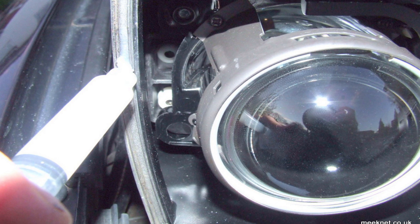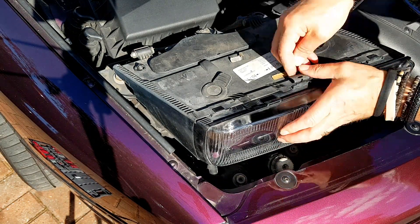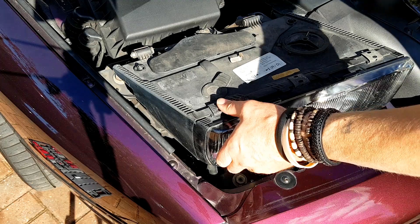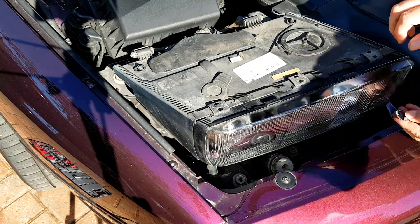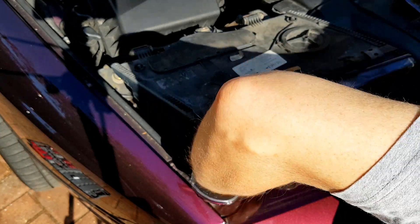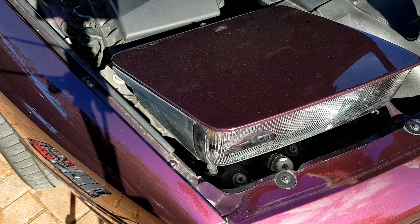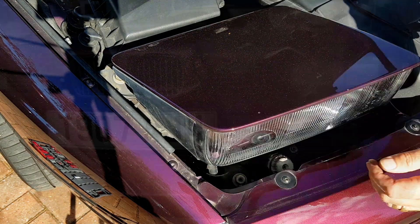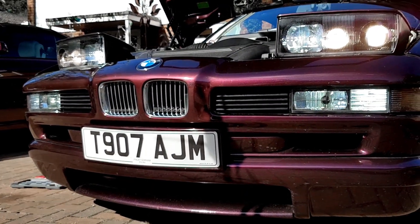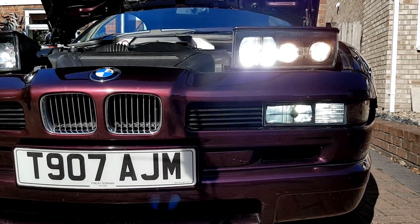Put some silicone grease on the headlamp seal and refit the glass, starting with the top clips. The reason I said keep the bottom clips separate is that the bottom ones are always looser, and if you fit a top clip onto the bottom you'll have an awful job getting them on. Don't get them muddled up. Put the top cover back on with the single posi drive screw and that's it. I've done the left-hand one as well and it looks perfect — lovely, back to normal. Thanks very much for watching and I'll see you next time.